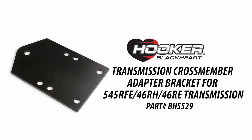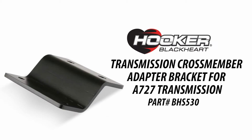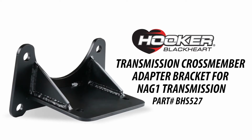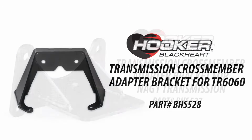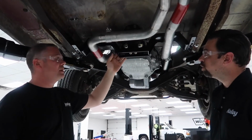Also, this thing's modular, like Tim was saying. With some adapters, you can go from 727, 46RE, NAG1, 8HP90, 8HP70, all that will work with this cross member. You'll just have different adapters and different bolt placement for your side brackets here, which is pretty sweet.